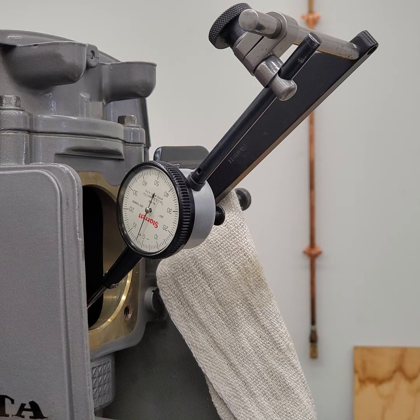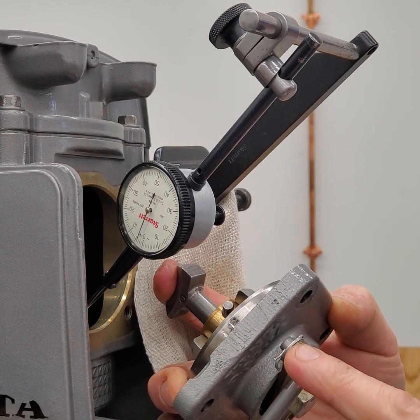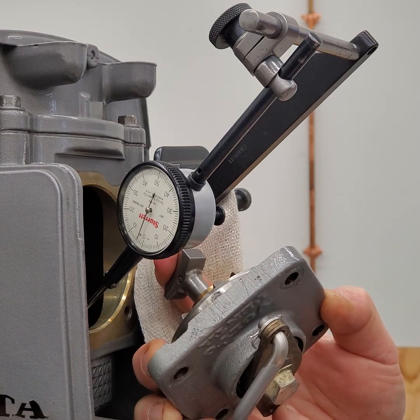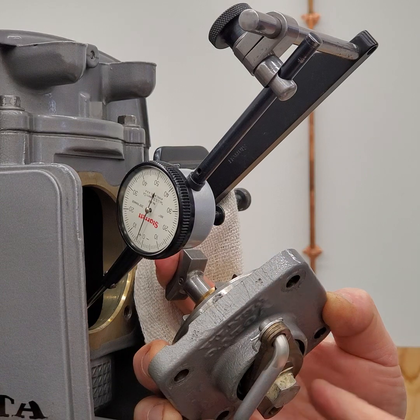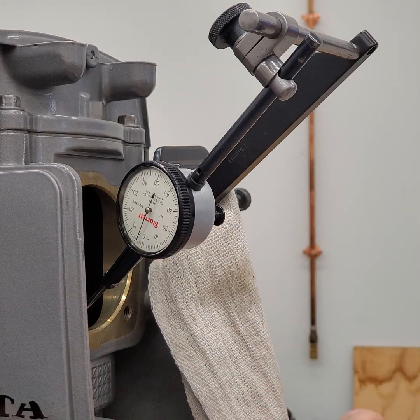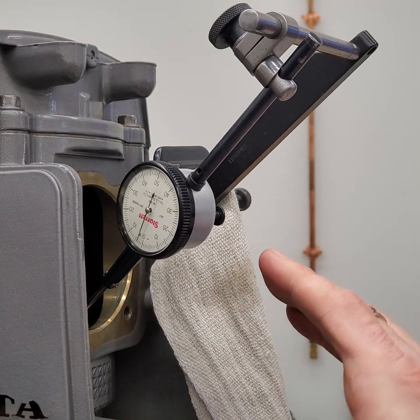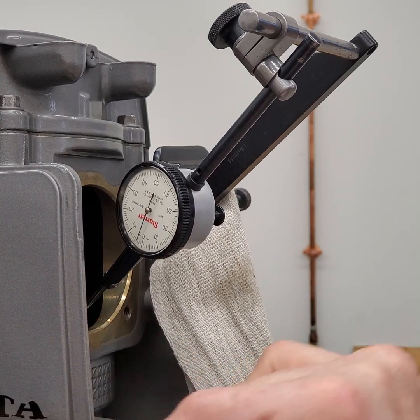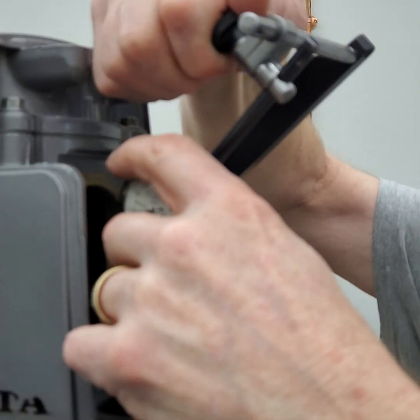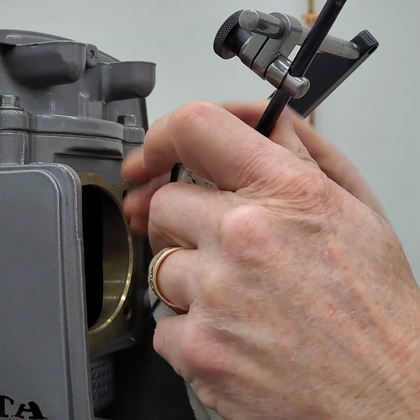Now I'm going to do the upper gear, which is the reverse gear. If this is an SX drive — single prop shaft drive, not a DPS — you can simply switch the cable from one side to the other on this bracket. That shifts the drive into forward when you push the throttle with the shift lever forward, or reversed into reverse. These drives can be run in full forward with the lower gear, normally DPS, or full forward in the upper gear on SX. That's in the book — you just have to read it and it'll tell you where to put the cable.